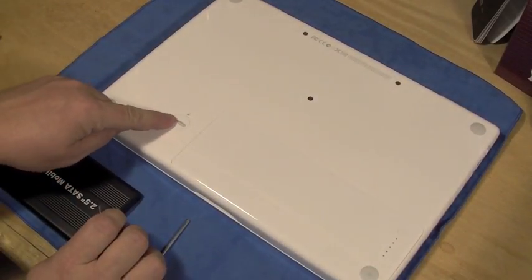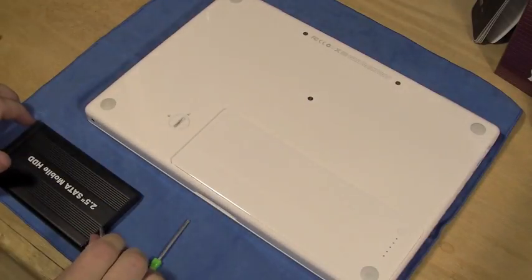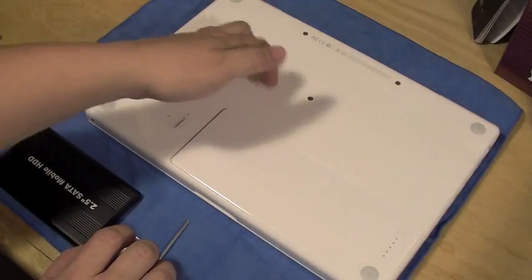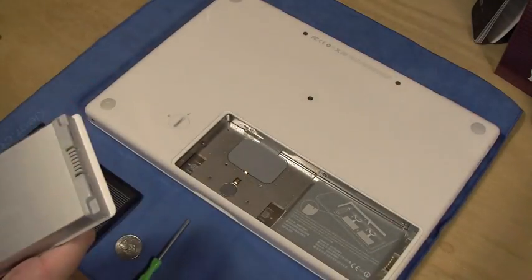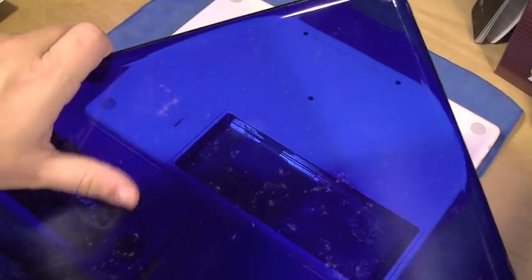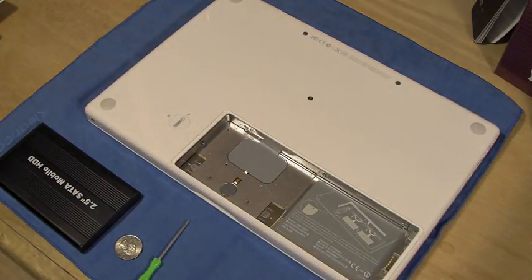What we're going to do is take the quarter and turn that to the unlock position, which will allow us to remove the battery. The MacBook is off, by the way. I did clean it up as best as I could — I had the spec see-through case on there, and let me tell you, it left a little bit of dirt in there. That was dirty — I need to take that off more often. There was a lot of build-up, and I'm assuming that's from the fan blowing and the holes not being thoroughly open to let air in.